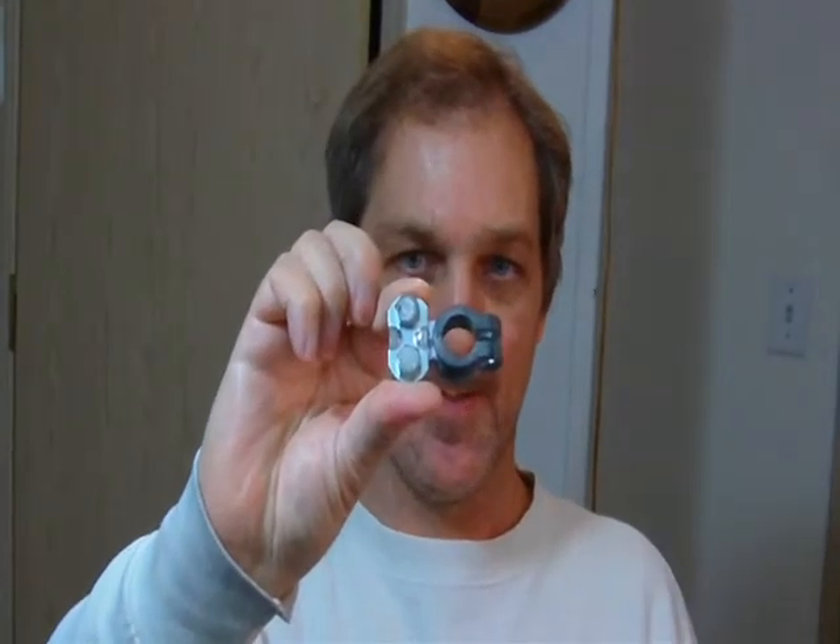The biggest problem with using generic clamps is there's a heavy lead that comes off of here and goes into the power relay center. If you buy just a standard basic battery cable from the auto store it's not going to be equipped for that — you're going to have installation problems and possibly problems with your computer. You need to buy the factory cable. If you use a universal battery cable and just patch the wire together to the power distribution center, you may have problems with corrosion, a bad connection, or a bunch of issues with your computer. I'd recommend using the factory cable — I've run into that problem several times myself working as a technician.